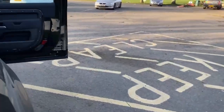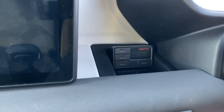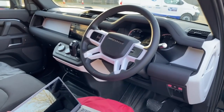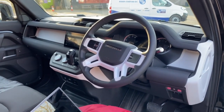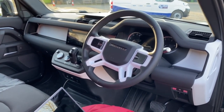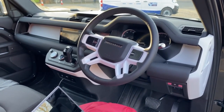The processor comes with a DRC controller that lives in the car — it still has its protective cover on the front. That enables you to adjust the level of the subwoofer and also change the listening position. We have preset A and B — preset A is driver focus, which is where it'll be most of the time, and preset B is the same equalization but time aligned for the centre, so driver and passenger both get an equal effect from the DSP.